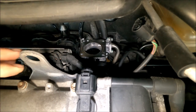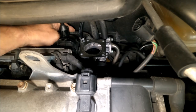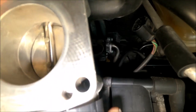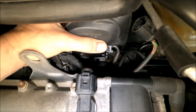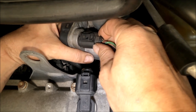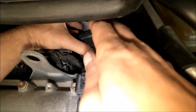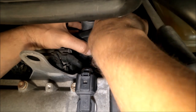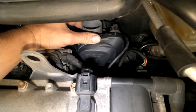The two nuts are tightened, everything is fine, the hose is connected and in the bracket correctly. The throttle body is nicely clean. I go from this side and put it in — first I connect the connector to the throttle body. It should click — and it clicked. Now I install it down, and it needs to seat on the gasket. I think it's okay.